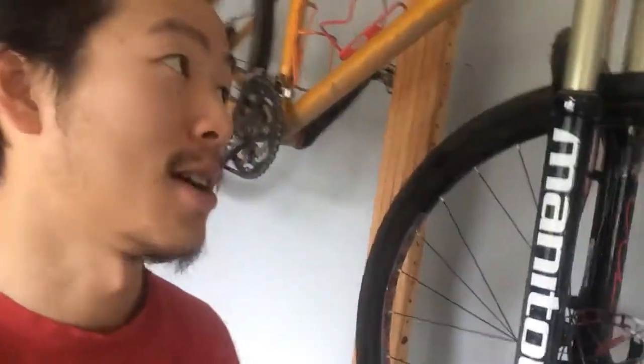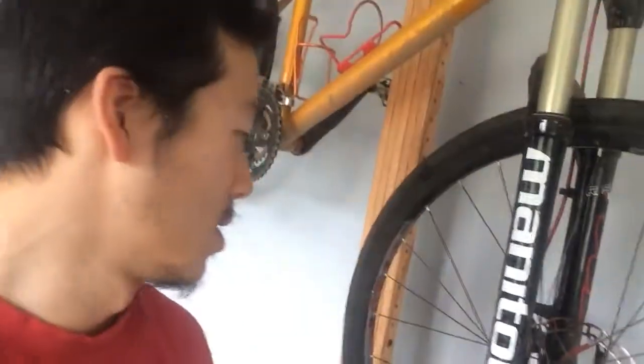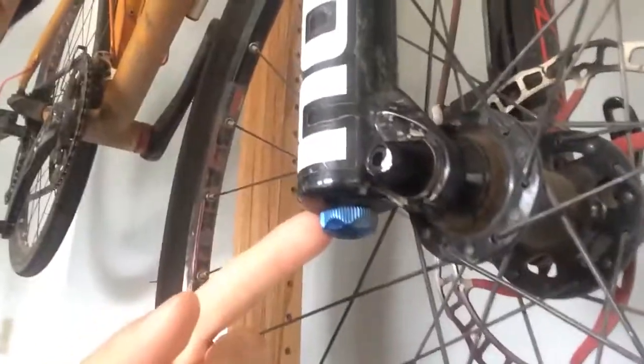It runs the intrinsic damper, intrinsic plus with the ABS thing. ABS damper, the absolute damper. That's the low speed adjustment knob. When it's locked out, it's completely locked out, like rigid, and just a rebound adjustment, and then air pressure over here.